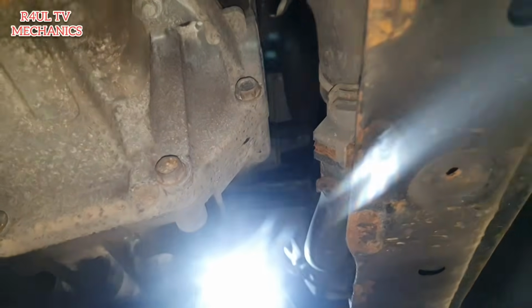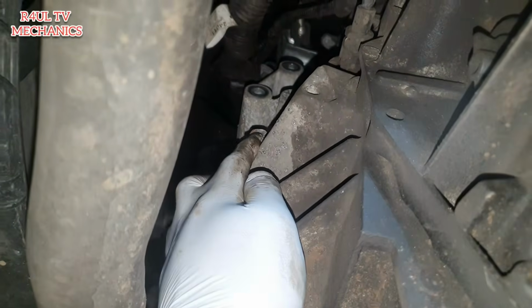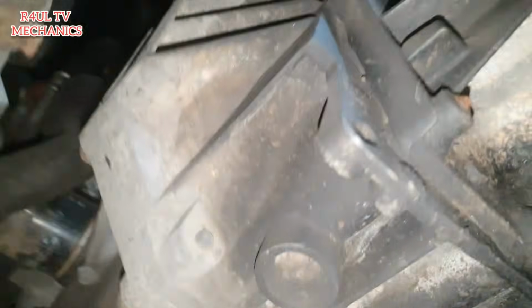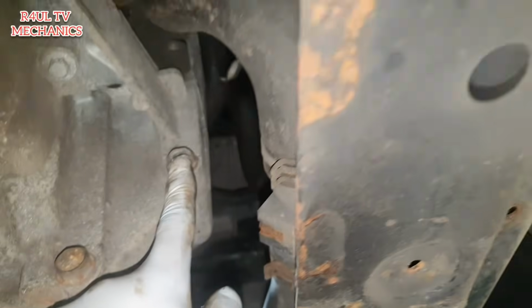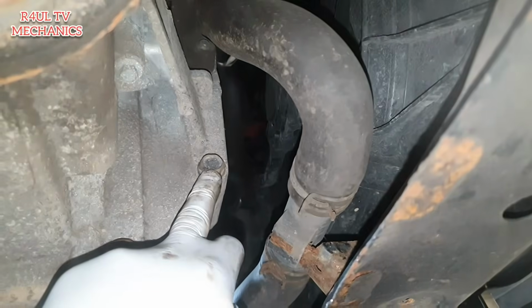is we're going to take the bottom bell housing bolts off, and one of the starter bolts that goes on this side, as you can see there, just there, we're going to take that off. So take that starter bolt off. That was a 16 on this side there, and then we're going to leave one bolt on. Okay, leave it slackened, but leave it on. That'll be our last bolt. We'll use this one as the last bolt.